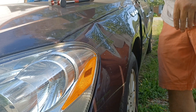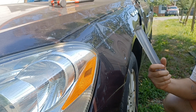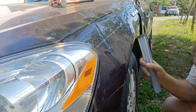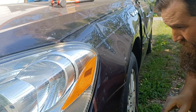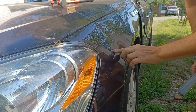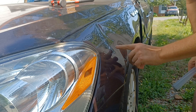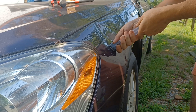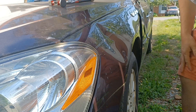Now we'll show you the trick about how to pull. Most families are going to have a hot glue gun somewhere around the house, and you don't need the torch that I'm about to use. But if you get a few hot glue gun sticks, you can actually use your hot glue gun. Apply where you want to pull on the dent, whether it's high or lower — right now we're going to start in the center. You can apply hot glue there and then stick a few hot glue sticks to it while it's still hot, let that dry up, and then you'll be able to use these to pull outwards. The hot glue will peel off the paint and it shouldn't cause an issue.